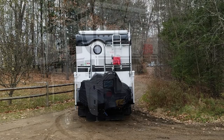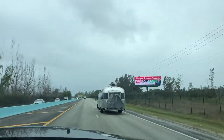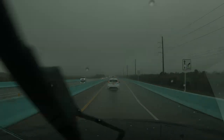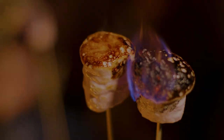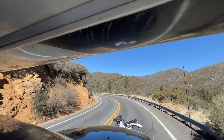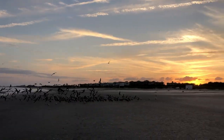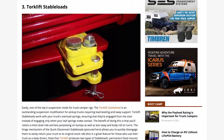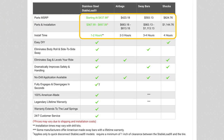When we first hit the road back in 2019, I wanted to see how things went before I started doing any upgrades. Within a few hundred miles, I noticed several problems. The biggest one was rear end sag, and that caused my headlights to be in the eyes of oncoming traffic. The second major issue was that the truck just felt soft and squishy — I did not feel confident driving it. There was also too much bouncing, body roll, and a lot of porpoising, especially on bridge joints. Once we got to Florida, I had about a month to solve some of these problems. I started searching for easy and affordable options, and that quickly led me to Torkelift stable load products. I found that the stable loads were advertised to solve many of the problems that I was having, and they were affordable and easy to install.